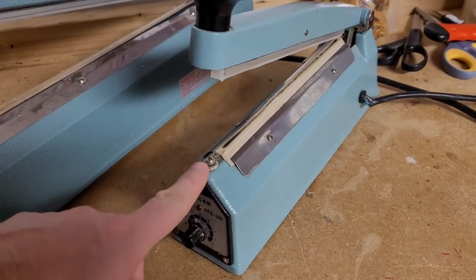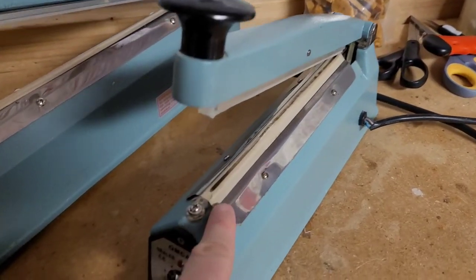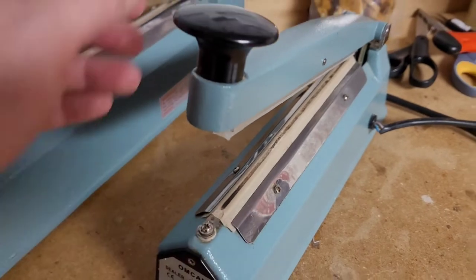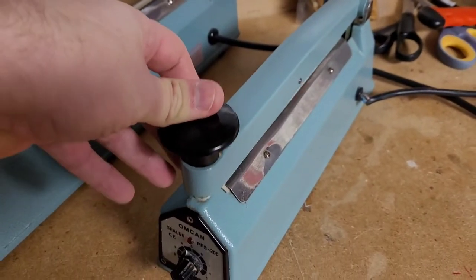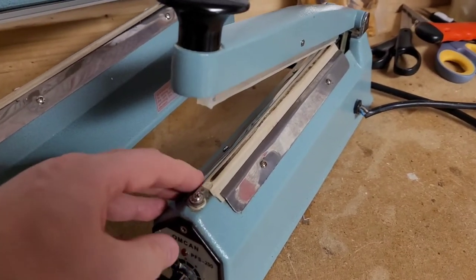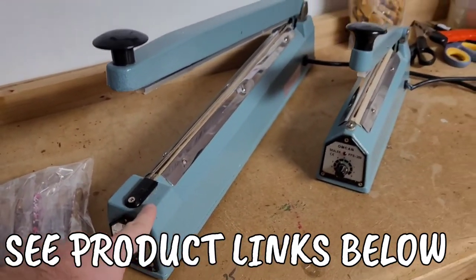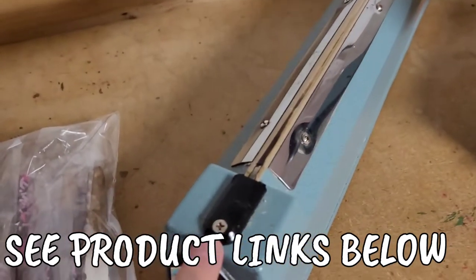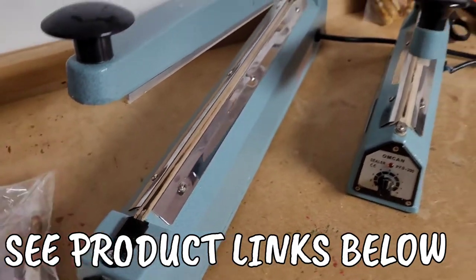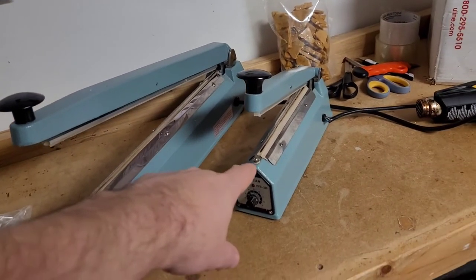The only thing to be aware of is that over time this will wear out. There is a metal cord — a strip of metal right in here — and as you use it you'll have to unscrew this and replace it. You see that little browning on the top? As you begin to use this over and over a few thousand times, this little heating element will actually go bad and you'll have to replace it. Normally when you buy these units you'll get one or two replacements included. You basically unscrew it, pull out this metal strip, and just replace it. Very simple, very easy to maintain.